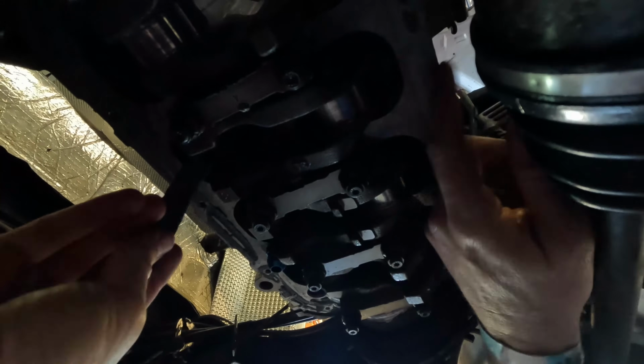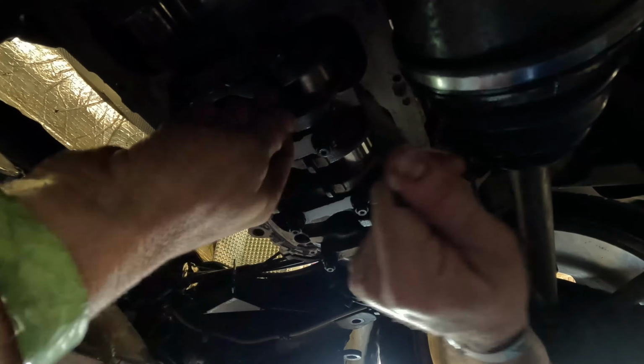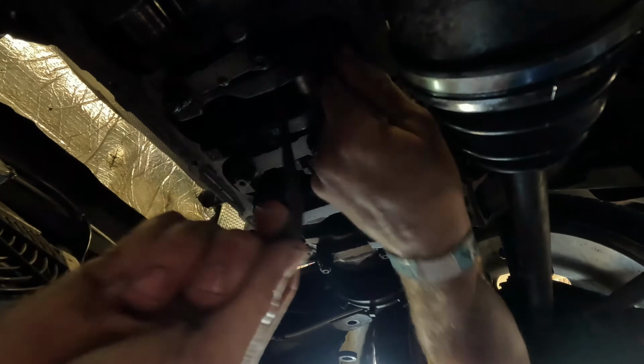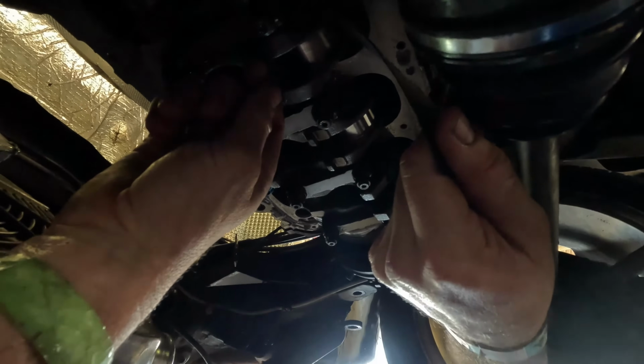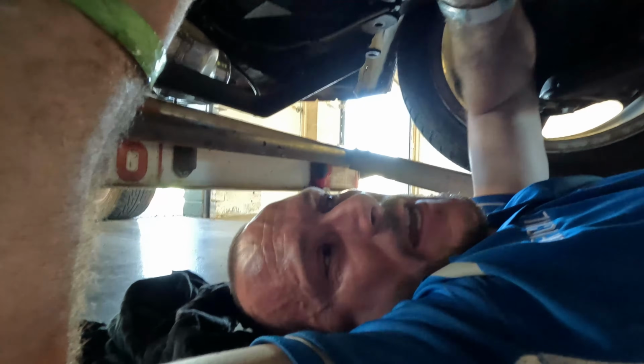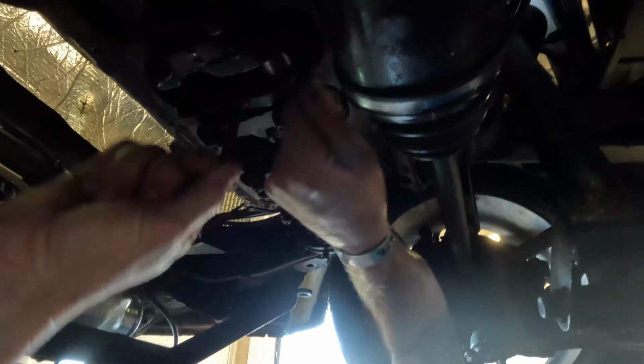I don't think we've actually tried yet doing the sandpaper jobby and also changing the rods, have we? Usually we try the sandpaper job, new set of bearings, but then because we realise the rods go out of round, it just trashes the bearings straight away and we can't use it. So this is actually the first time we're going to try sandpaper the crank, new set of bearings, change the rods. Well, if it fails after this, we're just going to give up. Yeah, but the rod is very obviously out of round.